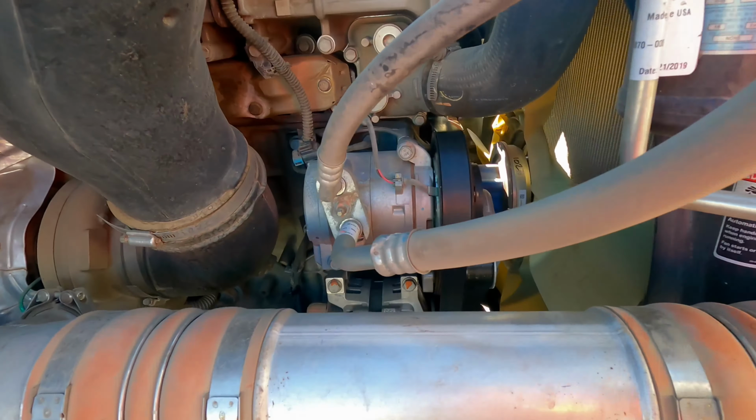The water pump is properly mounted and secured and isn't loose or leaking. It is also belt driven. The belt is not frayed, torn, or cracked, and has no more than 3/4 inch of play. Now you want to check the overall condition of the left side of the engine compartment. Check all the hoses for leaks and for proper condition. Check all wires for proper condition and fastened properly. Check for proper coolant level. There's no leaks. Check that hoses are not leaking and in good condition.